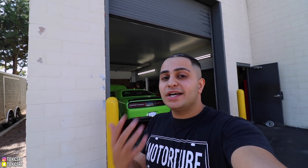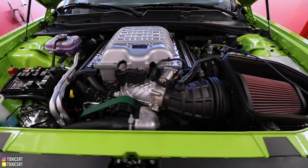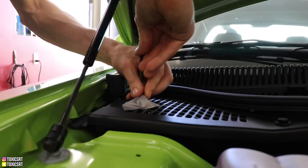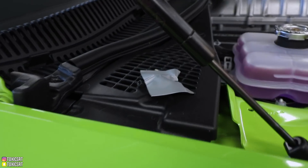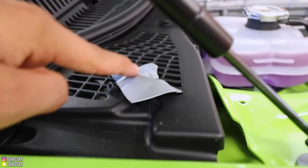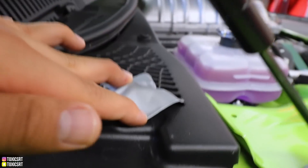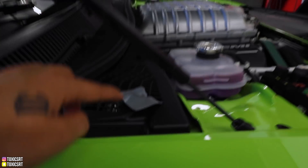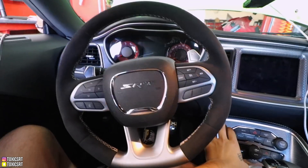Before we run the car, I'm going to use the race cool down, which is a feature from the Demon that basically uses the AC to cool the car down. We're going to do it without closing the hood. There are these pins that get pushed down when you close the hood, so we're just going to put duct tape over them to make it seem like the hood is shut. When the car thinks the hood is closed, we can use the feature to cool it down. Basically, when the hood closes, there's this little thing that goes down telling the car the hood is closed — we just pushed it down manually.